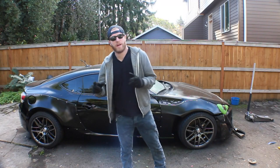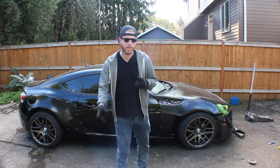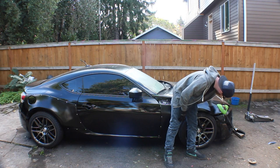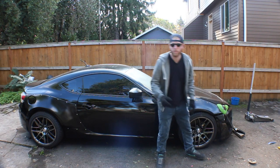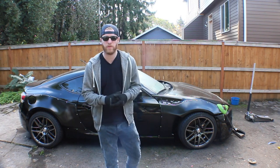What's up everybody? We are back for day two of our Rocket Bunny wide body kit install part two. We're going to start on the front first, and I'm going to be working on attaching this front bumper up to the fender. Then I'm going to grab the body saw and cut the pieces off of the front bumper that I need to in order to make room for the wheel.